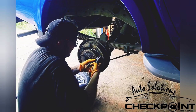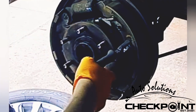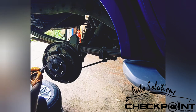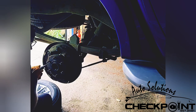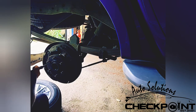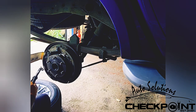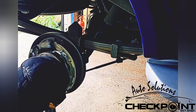We've just got to get the retaining clips that hold the old shoes on. They can be an absolute bugger sometimes, but if you're using the right tool it'll be a doddle. I'm just using pointy nose pliers. There are specific pliers to use for these, but call it laziness - I wasn't going to go hunting about trying to find them.